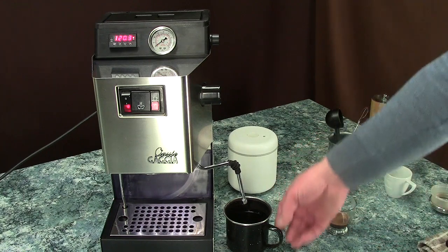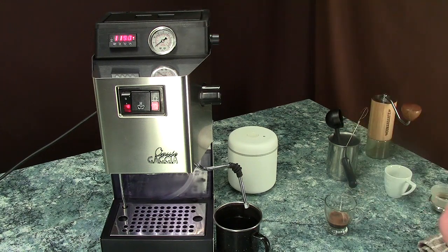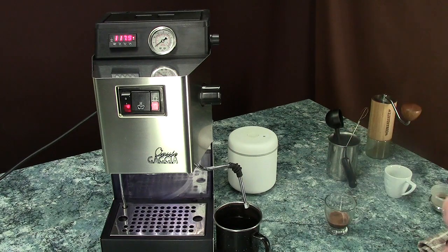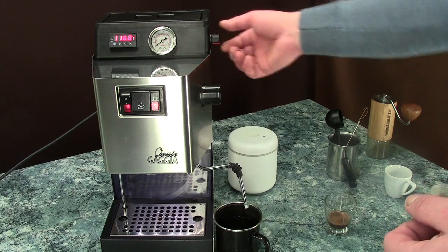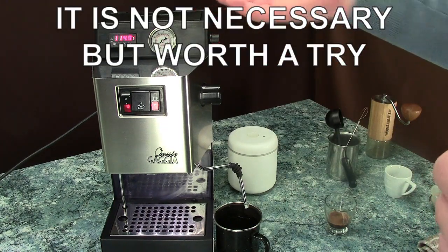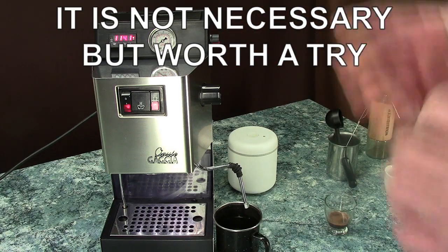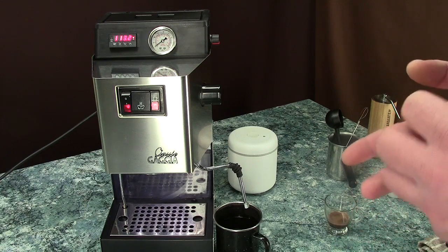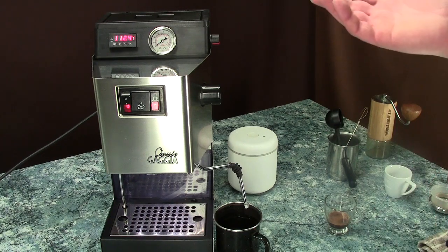Now, steam boost, what it does, because when you're steaming, you only have a tiny little boiler. It's only about 80 ccm, and obviously once you run out of liquid there and the steam, it's not going anywhere further. What you can do with the boost box, you can set your dimmer to a really low setting, and I also like to set the steam temperature slightly higher than normally, because basically I keep them on 137 Celsius, but whenever I use the steam boost, I like to add another 10 Celsius, so set it to 147. That means your boiler is going to be hotter, but it's going to help to compensate for the cold water you introduce to the boiler while you are steaming.